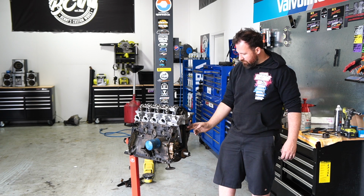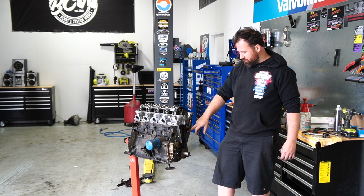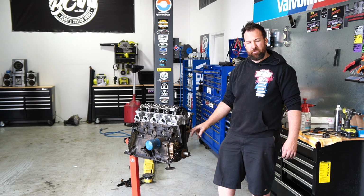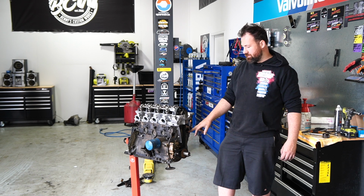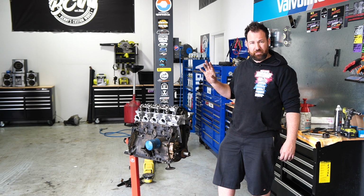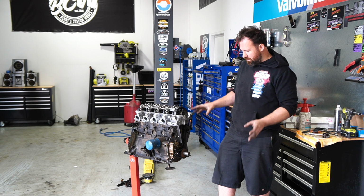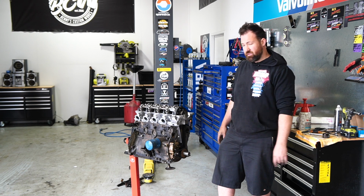We've also got our oil pressure retention sleeve in the block, because this front journal on the balance shaft is actually pressure fed. So if you just pull the shaft out and don't replace something in there, it means you've got zero oil pressure basically. So yeah, all of these things together means it's pretty much time to put the timing cover on, and then once we do that, I'm gonna have some lunch.